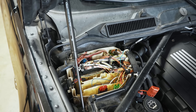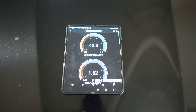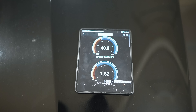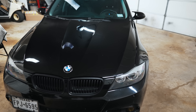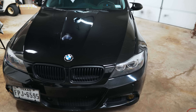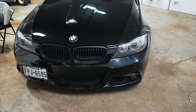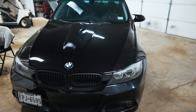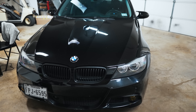The car is running perfectly. I'll get the DME box put back together, then go fill up with some ethanol and see how percentages change. Just got back — it went up to 40.8–41% peak. The local gas station is inconsistent with ethanol content, which used to be frustrating. Before, if I didn't get the calculation right my tune would be off. Now running ethanol is seamless — whether I lend the car out or the pump varies, it automatically compensates. If I just want to fill up with 93 in the middle of nowhere, no problem. Thanks for watching — please subscribe and like if you found this helpful.